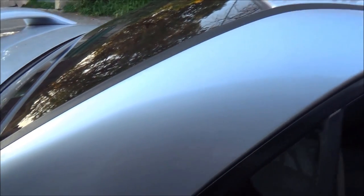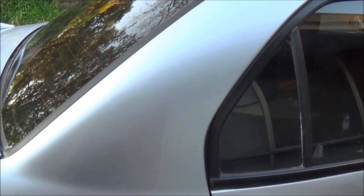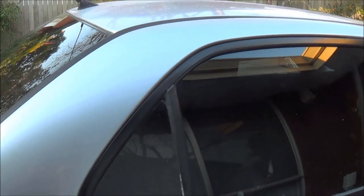Okay, it's looking good again, particularly where we brought the paint back. Now it's starting to become shiny. You can actually slightly see the camera's reflection in there, and you can't really tell the difference on these spray painted panels. This is the area with the painted colors. This area used to be totally sun damaged, the paint was entirely peeled off, and that was how we started, and this is how we finished. Good results, very happy. So that's how you paint a car with sun damaged paint.